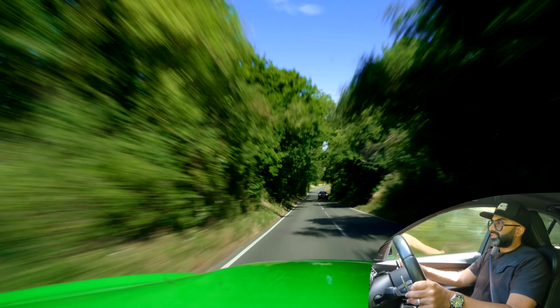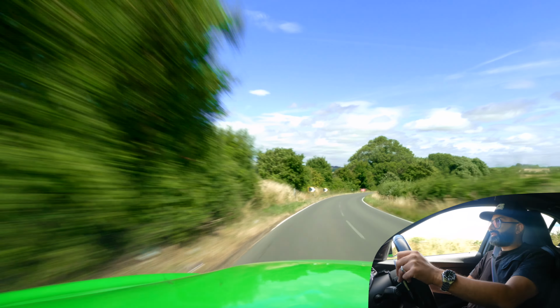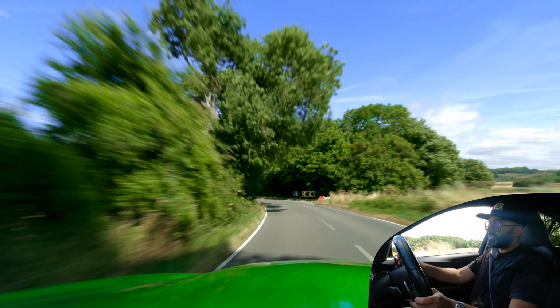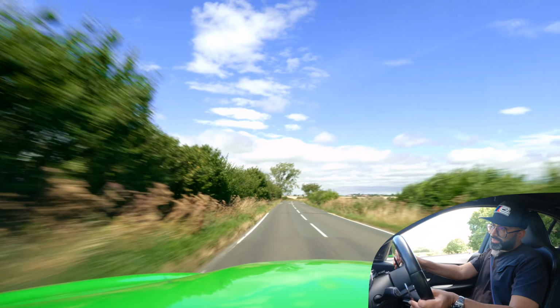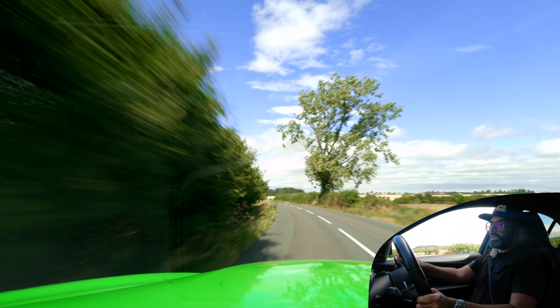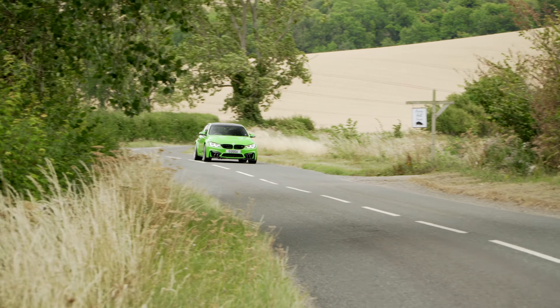Remember, this is now in the sport mode, so it's slightly stiffer and it's still super comfortable. And we are running this with MSS suspension at the moment, which is obviously helping the rear springs. With a triple spring rate, works really well with these, but I have tested them with normal springs like H&R, and they work really well with those also.